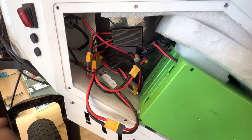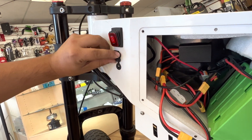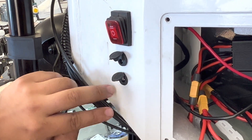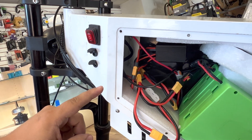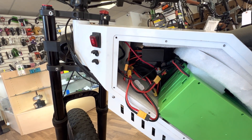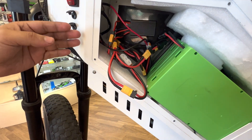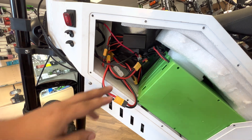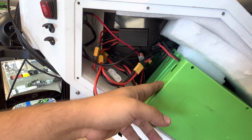The way it works is you'll have two charger ports, so you can charge each battery individually. It will only connect the two batteries together if the voltages match — so if one has more juice than the other, it'll drain one until they both match, then it'll discharge both equally. This is how a dual battery discharger setup works.